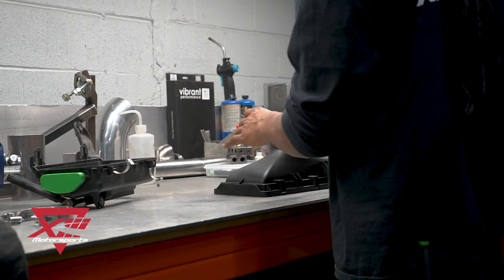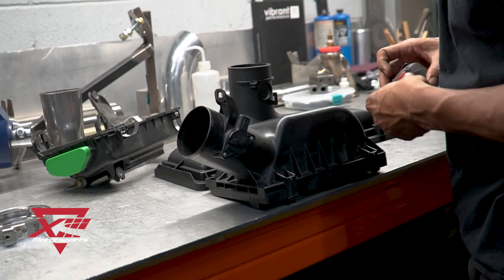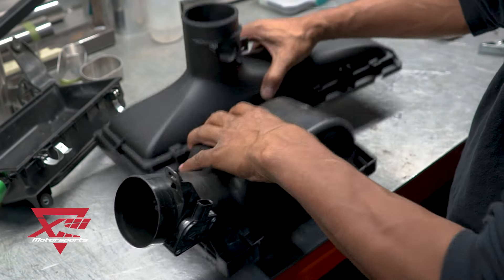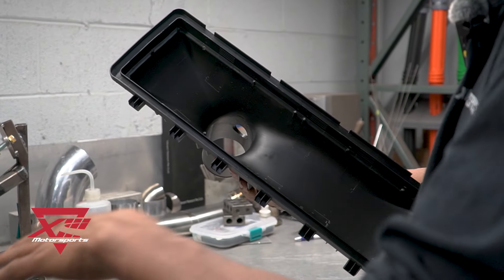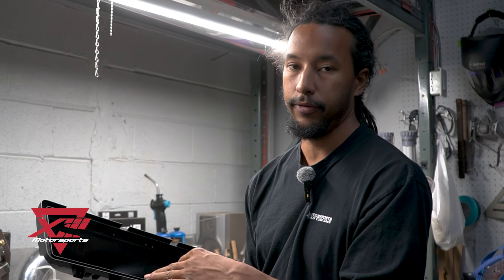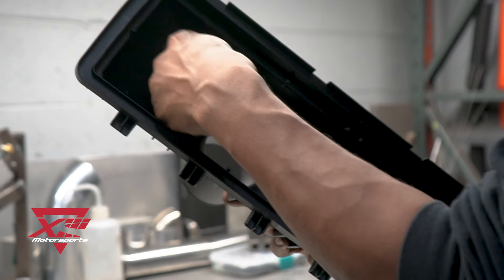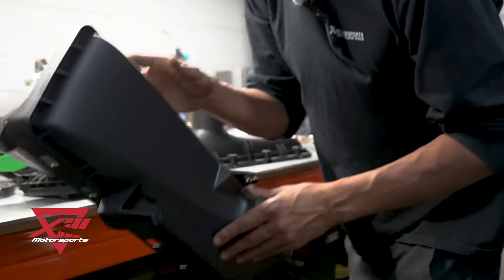Let's take a look at the MAF section. This is quite literally double the size — 10 and 3 quarter inches versus 20 and 3 quarter inches panel size, so it's literally double. That's going to give you a much better volume and higher surface area on the filter. As it gets clogged it'll still be able to flow, giving you less resistance to the air flowing in. There's also a really nice taper to this part, which should keep the airflow smooth and laminar.